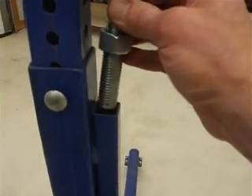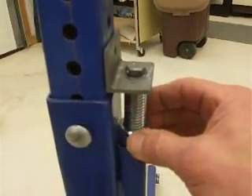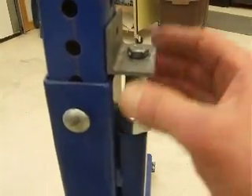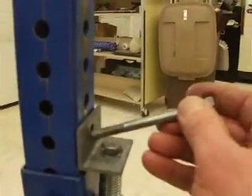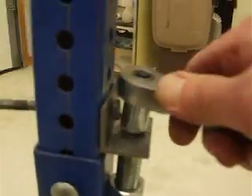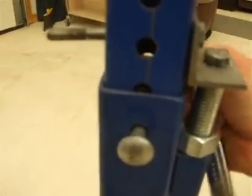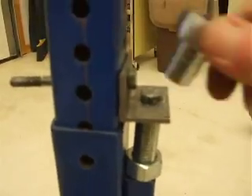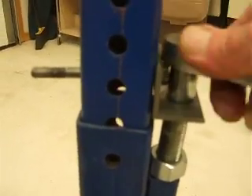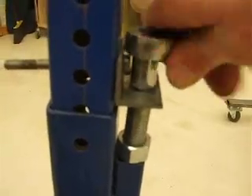And happily it just slides in here into the square tube that I used for the rotisserie — it's just a happy coincidence. You can see that the nut is trapped, and all I have to do is stick a bolt in here, go through that, grab my ratchet, and start jacking it out. It starts raising it — I can pull up that bolt and it goes up and down, raise it up a little bit or bring it down a little bit and raise it incrementally.